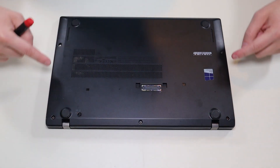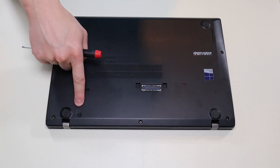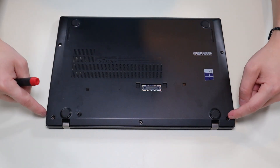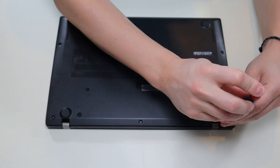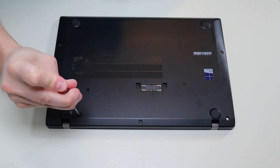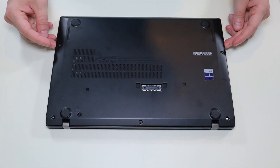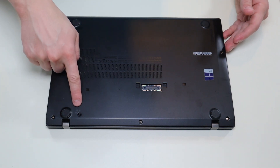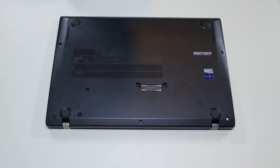I have these three screws up top, these two screws here, and that's your keyboard screw — that's a switch that releases your keyboard if that's all you're after. I'm going to go across and take all these screws out. All my screws are unscrewed. However, they do have washers inside of them that hold them in place, so you're not going to get them completely out. I've set my keyboard screw to open, and now the bottom case is released.